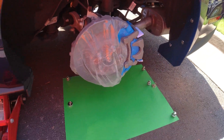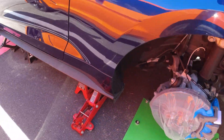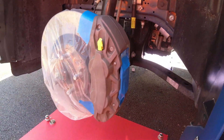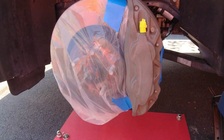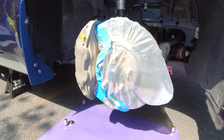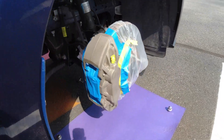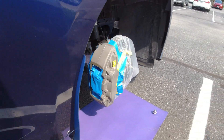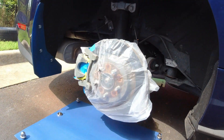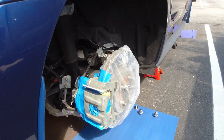Here's what it looks like after doing all four wheels — you can see a good amount of tape. I used index cards to isolate between the clips and the brake calipers themselves. On the front, we taped off the brake pad area and the pins, and put a little tape around the bleeder valve. Same on the passenger side — I used an excess amount of tape so the plastic doesn't rub against the caliper while painting. Index cards on the back as well to isolate between the clips and the calipers.